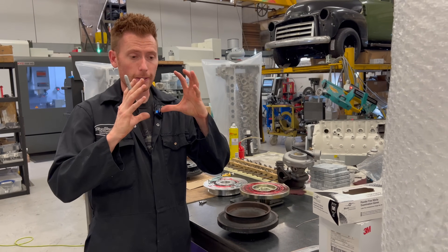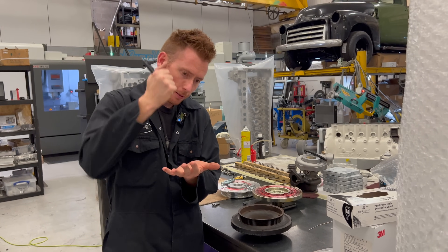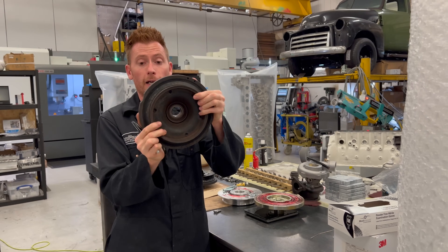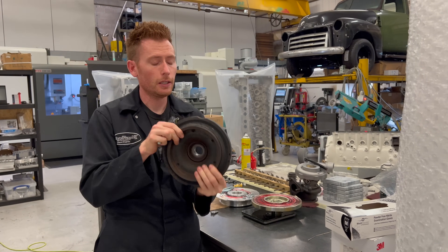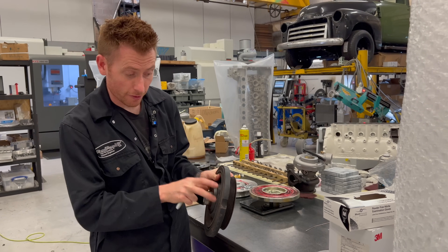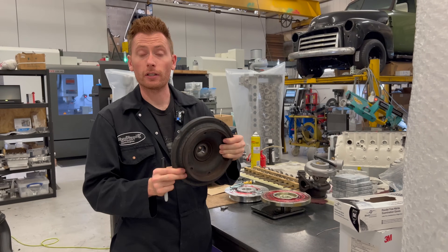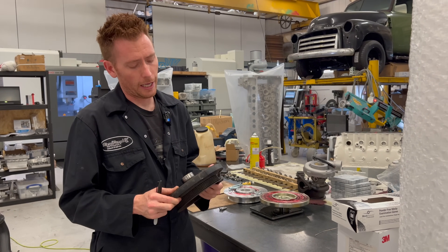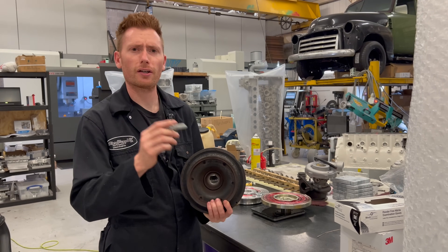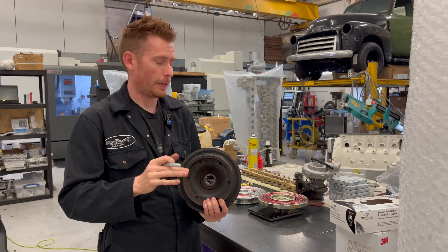Picture it a little bit like a wind-up gun — as the combustion hits the piston, bang bang bang bang, it's kind of going like that. The outer ring which is heavy and the inner ring which is heavy — these two bits that are flexibly rubber-mounted — are sort of helping take the shock loading, a little bit like a dual mass flywheel. But the actual driven surface is not rotating independently to the crankshaft the way a dual mass flywheel's friction disc would.